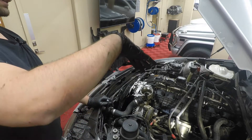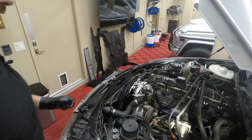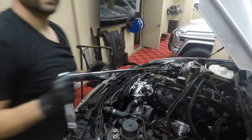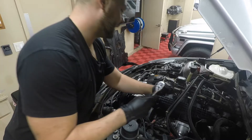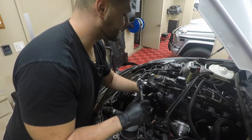I was tilting it the wrong way — it actually feels counterintuitive but you want to tilt it up and then get it in. Once you get that stud in the back corner you're good to go. You're supposed to torque these down to 11 foot pounds — I'm just giving them the old trusty hand tighten.